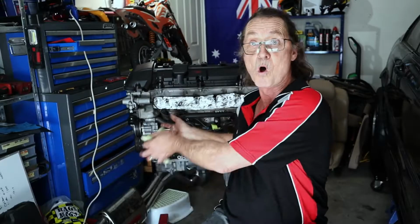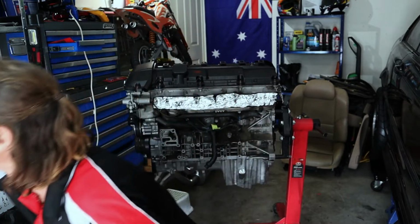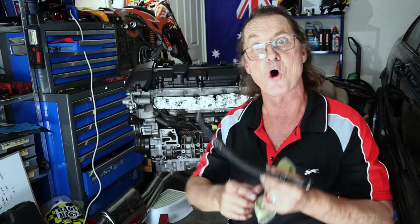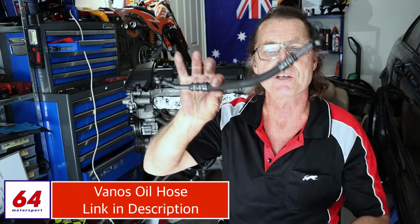But what's the other thing that you should replace and order at the same time you order your new gasket? Well, apart from an oil filter and some fresh oil, because it's a good idea to change the oil while you're doing this whole process, the next thing is this here, and this is the Vanos feed line. I would seriously recommend that you replace this hose as well.